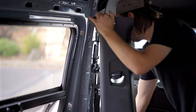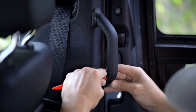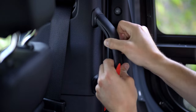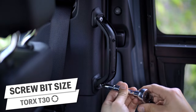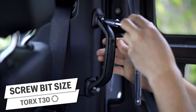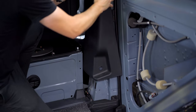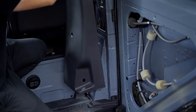Then simply snake the safety seat belt, sliding it softly through the slot. On the side with the slider door, you'll need to remove two additional bolts that attach the handle. Take a trim removal tool and slide it into a small recess visible near the bottom of the seam, pry the cover out enough to grab it and pop it off, then remove the bolts with a T30 torx bit. Our van has a power slider door, so that connection to the button needs to be removed too.